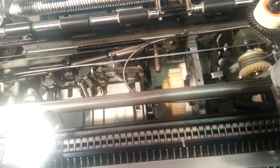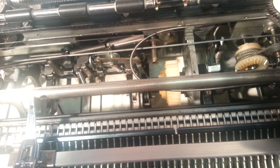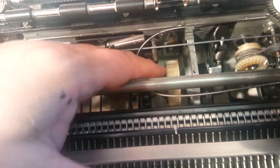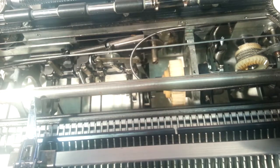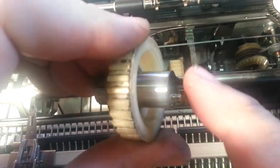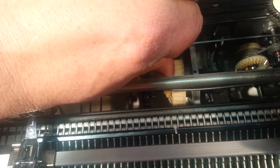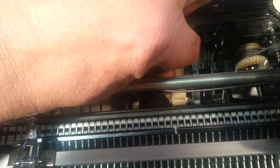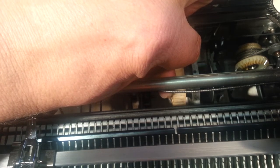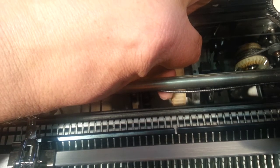Let me move the carrier a little more out of the way. You can manipulate this with the cycle tool — get that shaft to go on that bushing first, then you line up the teeth. Once you get it past the bushing, you've got to line up the pegs in the proper spot. You turn this until it matches — it takes a little bit of getting this just right, but it will go.